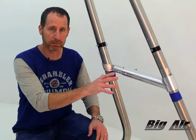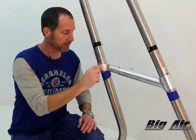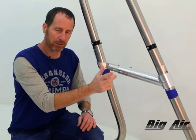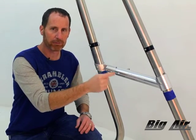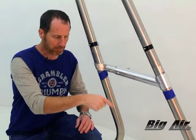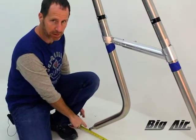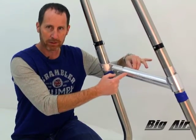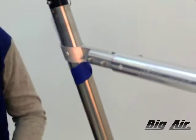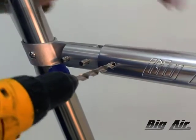We're on the last step of our cross brace assembly. We've got our pins going through our T-brace and our strut. Stainless holes are done — these are three-eighths, these are five-sixteenths. A little trick I want to teach today: we always like to have a tower a little bit in tension and compression. The centers of my mounts front to back are 43 inches. I'm going to make sure the mounts on my tower base are at 42 and a half inches — at least a half inch stretch — because everything's flexible to some extent. It is aluminum, so you can run at high speed. We'll finish this hole up and be done with our tower, ready to go on the boat.